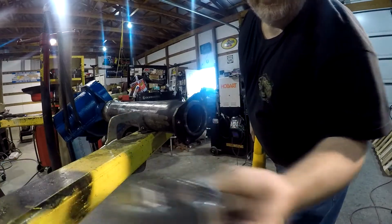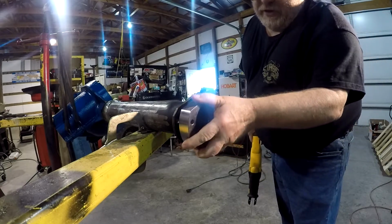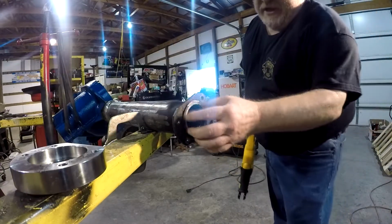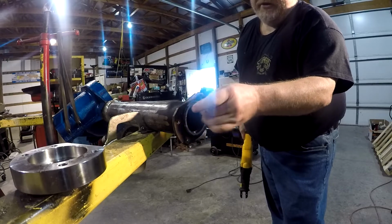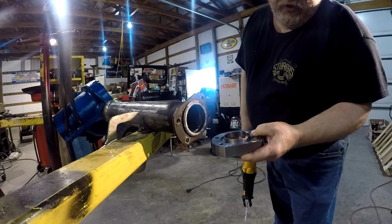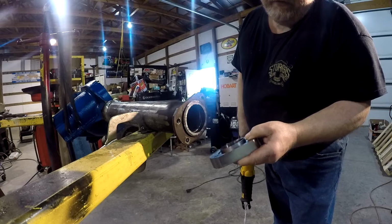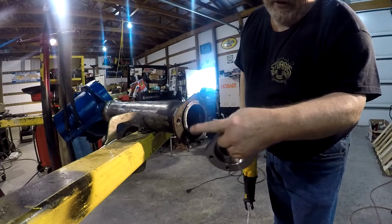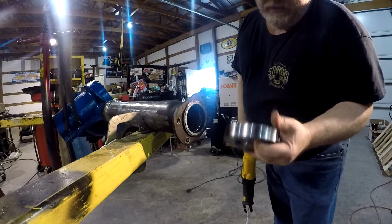And what this is going to do, it's going to allow this C-clip eliminator to sit right flush on top of here, instead of having the gap that I showed you before. We cut that right off. We have a little bit of lip there to go inside here. They give you a little space for it to seat in. We'll be filling that with silicone so we don't get any differential fluid leak out around here. This will all be cleaned off and sealed. This will stay with the diff from now on.